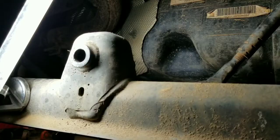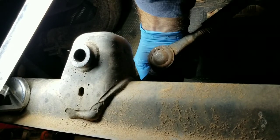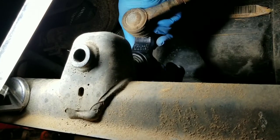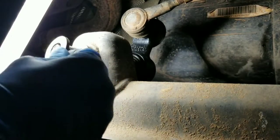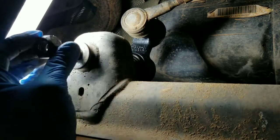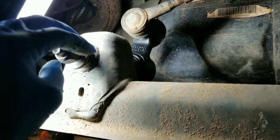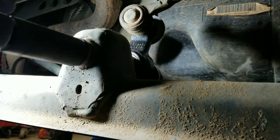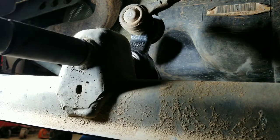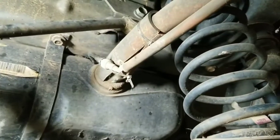And then the same thing before you crank down on it totally, then go ahead and get your center link mounted. Just take your original retaining bolt, slide it through the center, right back through the hole. Make sure you put your washer back on it, and then your retaining nut. Get that center tightened up, go ahead and tighten up your outer links.